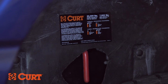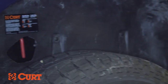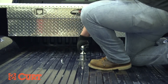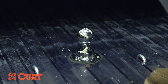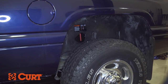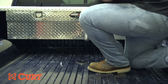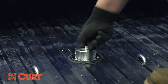To remove the pin and reposition the ball, pull the handle out as far as possible and rotate it clockwise until the locking pin is disengaged and locked out. Insert the ball into the cylinder by aligning the ball groove with the cylinder pin. If the groove and pin are not aligned, simply rotate the ball until it drops into place. Rotate the rod handle counter clockwise until the locking pin snaps back into position. When not in use, the gooseneck's trailer ball can be flipped over and conveniently stored within the cylinder and covered with a provided rubber cap.